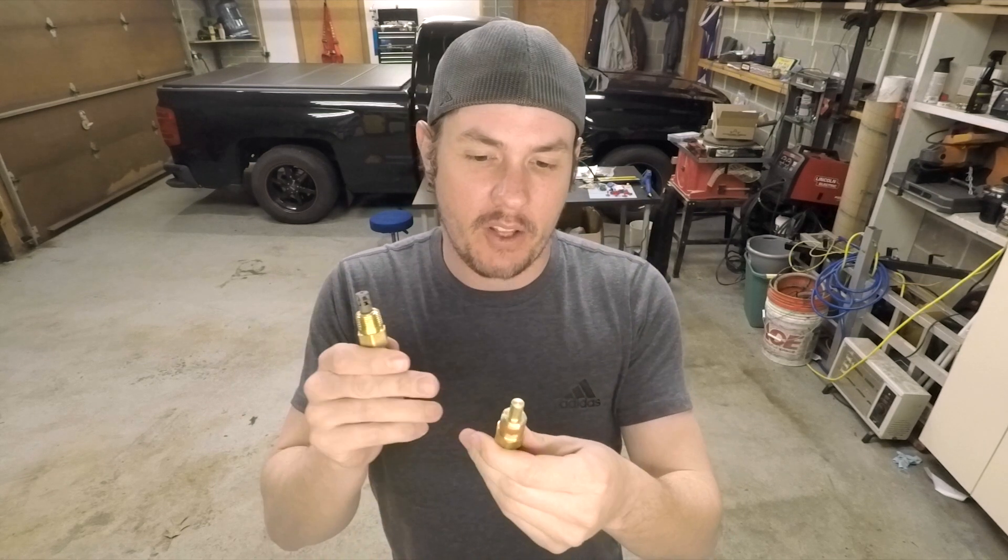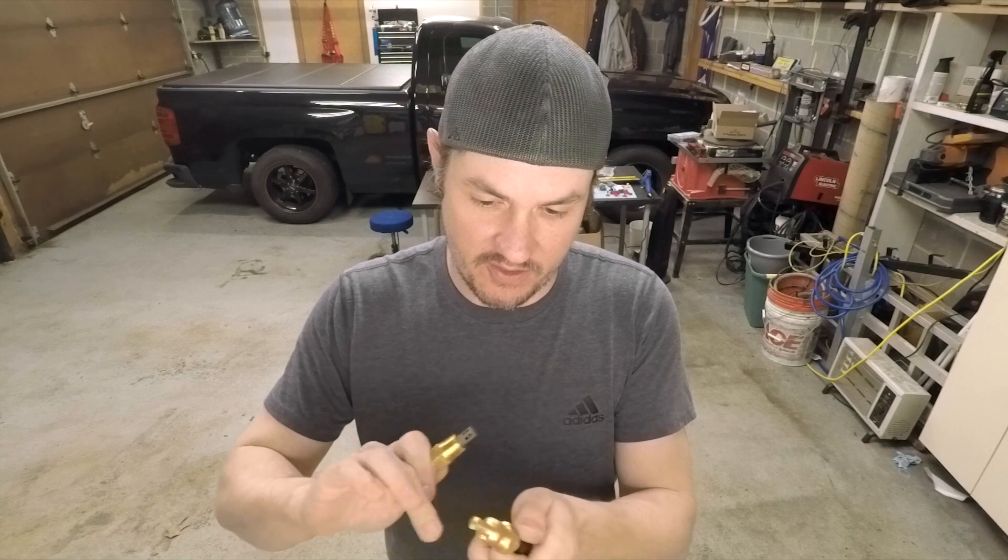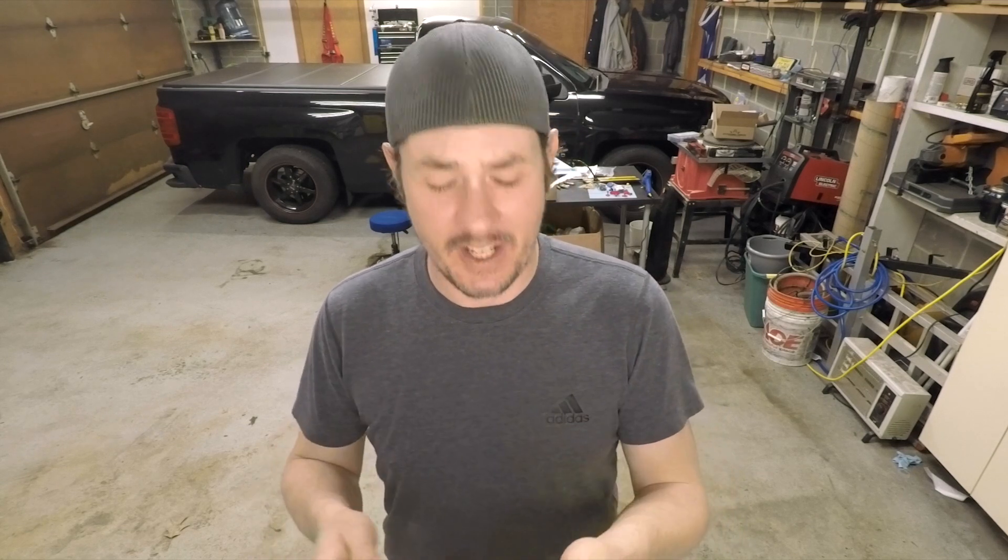It's just as I had worried. The reaction time on the engine coolant temp sensor is just not fast enough. As you saw on the video, whenever we were using the standard IAT, there was a pretty quick shift. I did six or seven different tests. The one in this video is the only one where you could actually see deflection on the IAT sensor — you didn't see any on the engine coolant temp. There is actually some methanol-water blend on this sensor. The plugs are a little different, but you can get it plugged in pretty easily — it was reading right, the scaling is right. I just don't know why you'd want to use it, because using this would probably be dangerous since it would not react fast enough for your dynamic airflow tune.